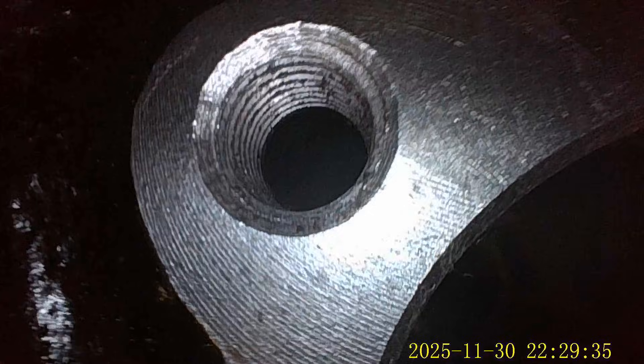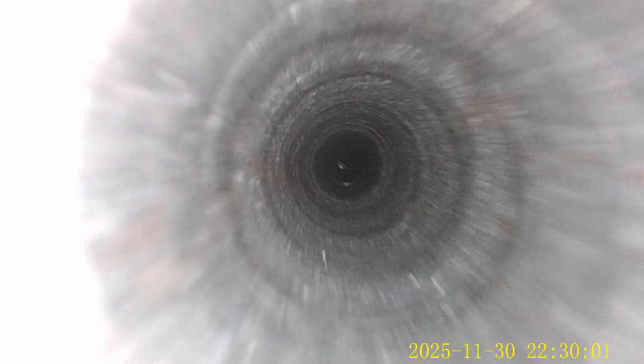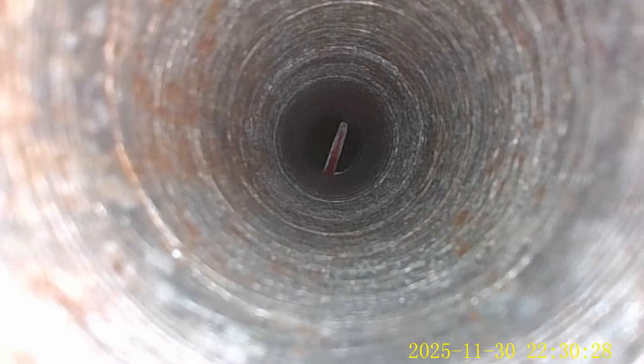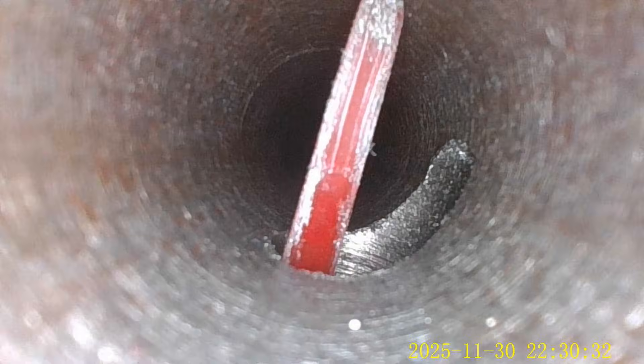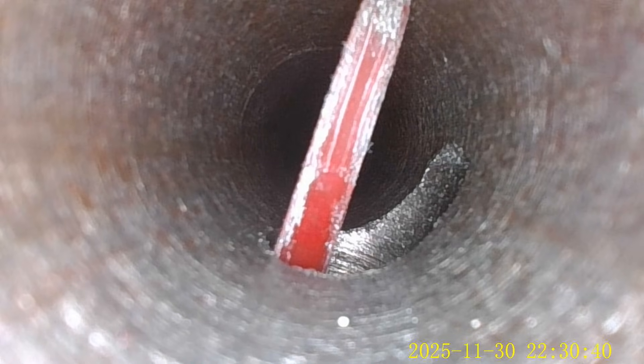When I say the main galley, this is what I'm talking about right here. That isn't there on the Cleveland block — that block has this, which is the top, and then the one way in the back where the distributor comes through. This block has this one, which you just saw, and also that one back there where the distributor comes through, but it also has this one — that's the priority aspect. Now when we go through here, you're going to see where it's going to shoot off the mains first. We know already that it went through the first main — that will feed the cam and the first cam bearing. Now we're coming up to the second one right there, feeding the main, and then what feeds the cam is another oil hole, just like on the stock block.